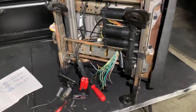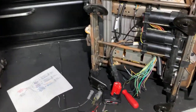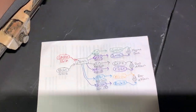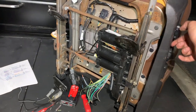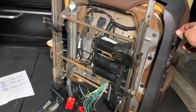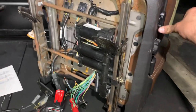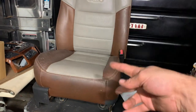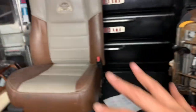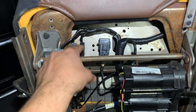Check it out — I kind of jerry-rigged it just to test them with a spin thing. It's been about two years since I bypassed the memory module, so this was a bit fresh for me, but my guide was right on the money. I got my Milwaukee jumper on there — we're going to make it go back, bring it back up, make the front taller, make the front smaller, make the back taller. Boom — we got that seat moving. The passenger seat doesn't need the bypass — it's just power and ground, that's all it needs. These 08 to 10 seats don't have airbags in them, so don't worry about that. The relay is for the heated seats and these go to the heated elements for your butt and your back.